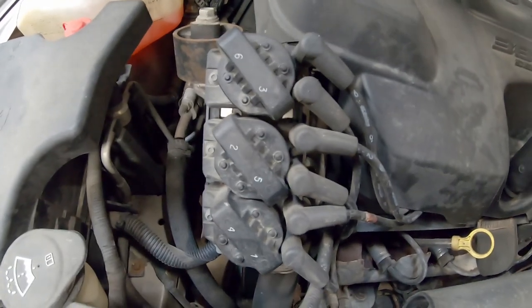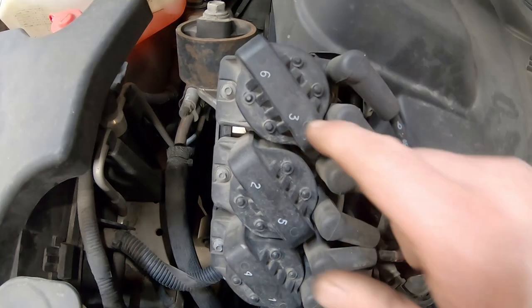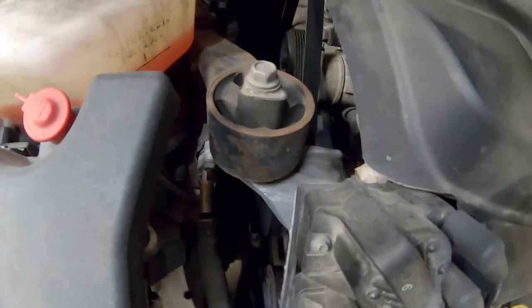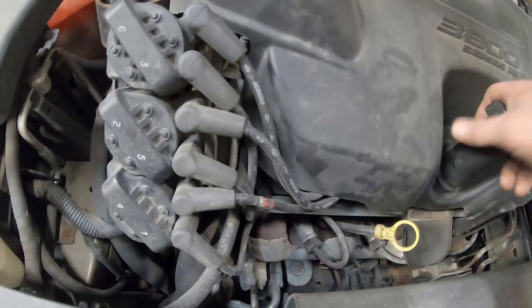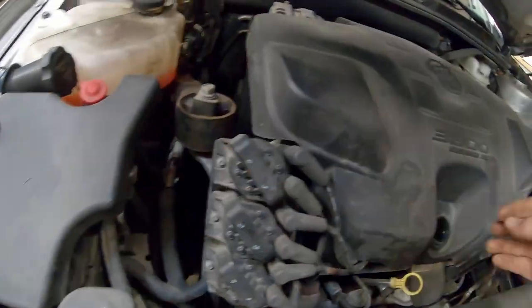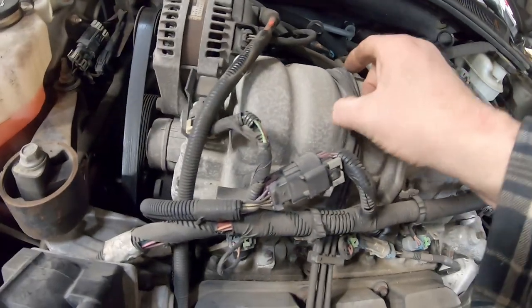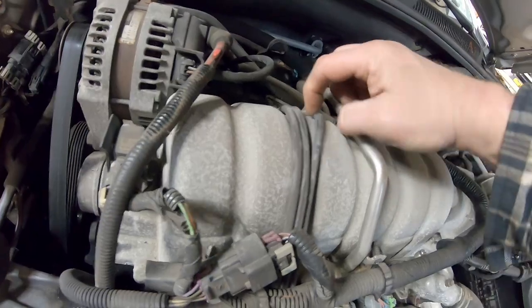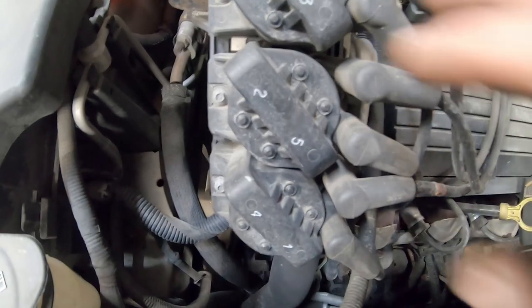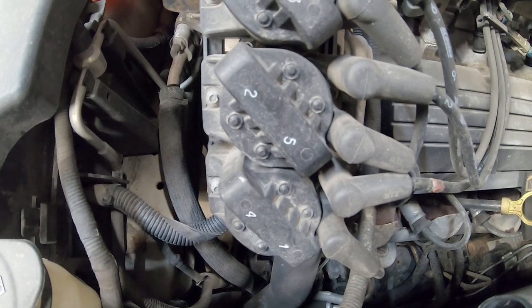Here's our set of ignition coils. And if we look right here, 3 and 6 are the same coil. I bet this coil is bad. I don't see any cracks in it. It looks like it's got ACDelco numbered plug wires, and I'm pretty sure those are only factory — even if you buy ACDelco's aftermarket, you're not going to get them numbered. These should be replaced. This is a pretty good motor. Let's move on to checking it. I think I'll pull one of these front plugs out. We'll let it cool off just a little bit.